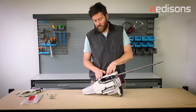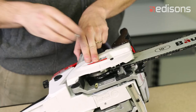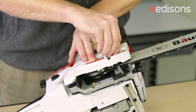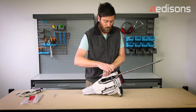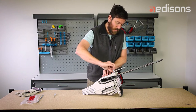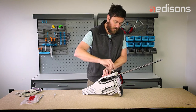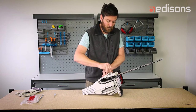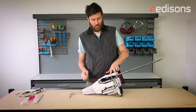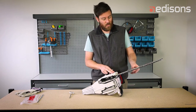Locked in. This will sit reasonably flush and you'll be ready to attach your nuts. You don't want to do these nuts up fully tight yet, because we'll need to adjust the chain. Once you've got the locking bolts and nuts done up just finger tight, we can then adjust the chain.